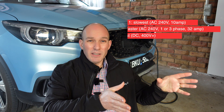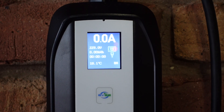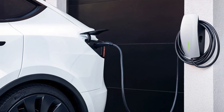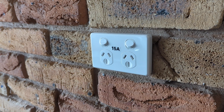You may have heard the term level 1, 2, or 3 charging. Level 1 is basically your bog standard wall outlet. It does fine for electric vehicles — you can just plug in the one that came with your car and away it goes. It gives you about 10 kilometres of range per hour. Then you've got level 2, where you might have an actual faster charger installed by an electrician, or you could opt for a 20 amp or 32 amp socket to be installed. That's your level 2.